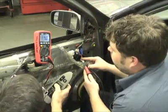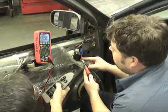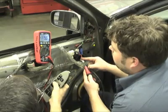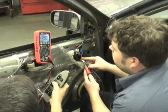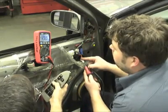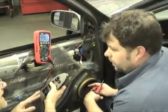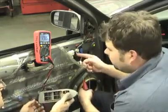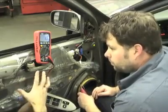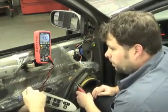Whenever I apply the load, the voltage will drop. We've just tested 100% of the entire circuit. The only thing we didn't test was the motor. But if you've seen the voltage drop, obviously you're not going to pull the motor, you're not going to waste time ohmming it out, going to the parts counter, and then writing up that service order you have to explain somehow.